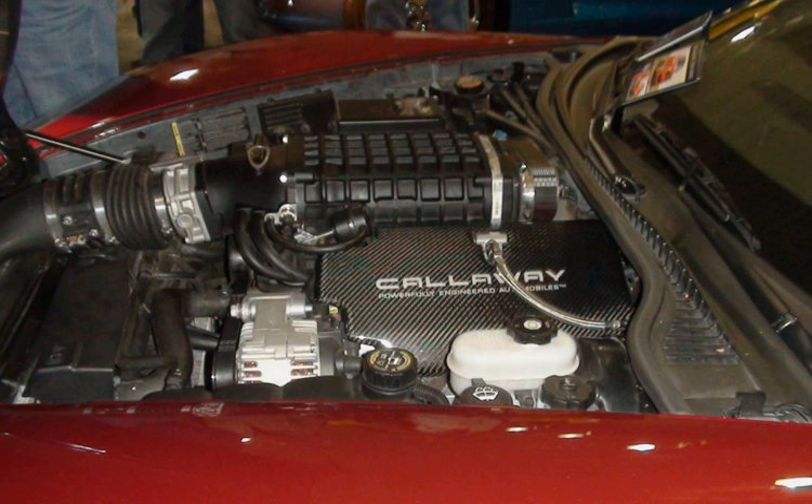LR4 applications: 2003–2006 Chevrolet Express/GMC Savanna, 1999–2006 Chevrolet Silverado/GMC Sierra 1500, 2000–2006 Chevrolet Tahoe/GMC Yukon. The Vortec 5300 LM7 is a V8 truck engine. It is a longer stroke by 9 mm (0.35 in) version of the Vortec 4800 and replaced the L31. Displacement is 5,327 cc (5.3L, 325.1 cu in), from a bore and stroke of 96 mm × 92 mm (3.78 in × 3.62 in). Vortec 5300s are built in St. Catharines, Ontario and Romulus, Michigan.